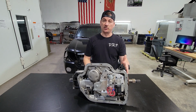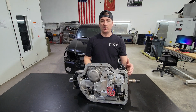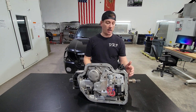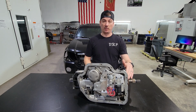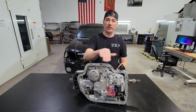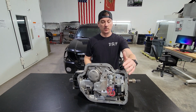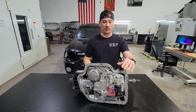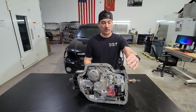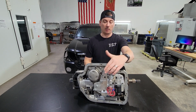But what we're doing is making some slight modification to the pump. And what we're doing is stopping the conventional or the OEM feed that GM had put into this pump to feed the converter. We're stopping it from that point because we want to be able to control it. All we're doing is moving that ability a little bit farther downstream, just as efficient. So here, okay, and in our kit we have fixture plates and all the instructions, tooling, hardware, everything, gaskets, you name it. Here we're mounting our block and our solenoid right here on the valve body.